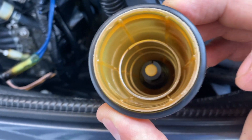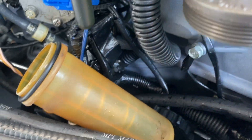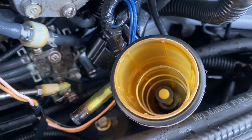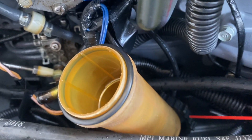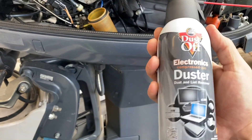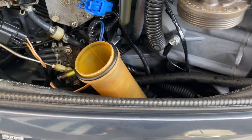Visually inspect inside the bowl — you should have a spring, and some of them have a little red o-ring, which is just a float. If you have water inside the bowl, you'll see the red ring floating. This one appears not to have it. Go ahead and empty it out if there's any water or junk in there — just flush it out. Remember there's a cable connected to the bottom of the bowl that you don't want to rip out. What I like to do is empty it and use a little compressed air to shoot in there and remove any debris.